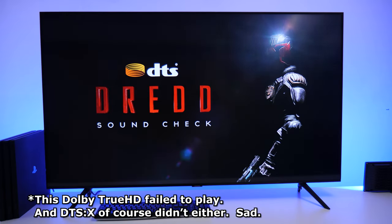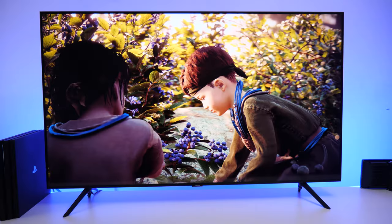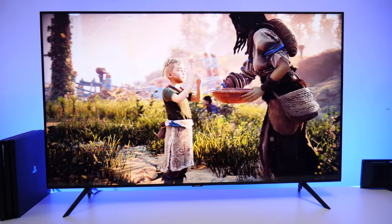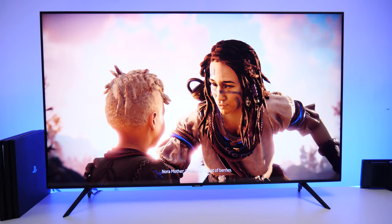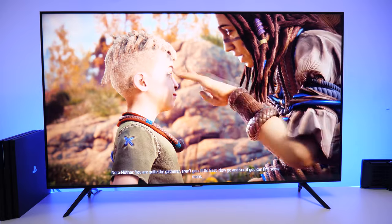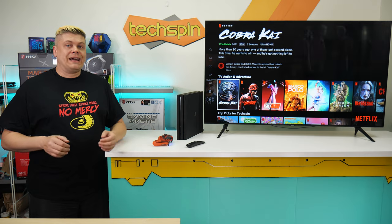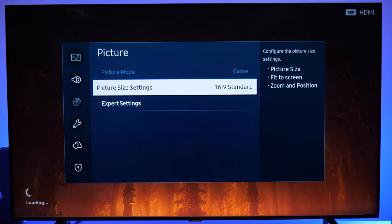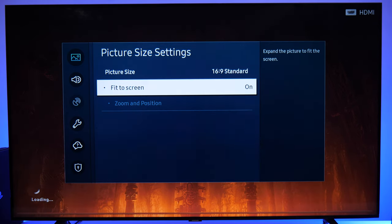Although all plastic, it's well-built and sturdy with a little wobble. The picture is good, though gradients show a little banding in all colors, more noticeable in dark shades. HDMI sources display full screen so all source pixels match TV pixels one-to-one. Overscan stretches the image, reducing resolution and introducing blur, so we expect zero overscan on new displays. But like some other Samsung TVs, overscan is on by default — fix it by going into the aspect ratio menu and changing from 16x9 to fit to screen.